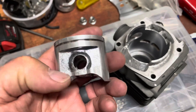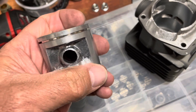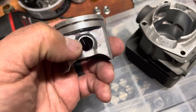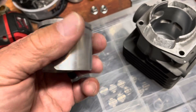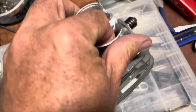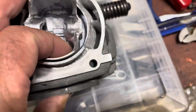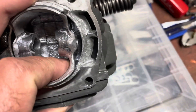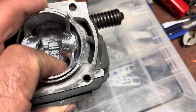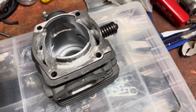We took material off and lightened the piston like I did on the last 2166 Jonsered build. I think I like that modification — when you put it in and it comes down to bottom dead center, it doesn't block off the transfer area, it gives more feeding area for the transfers. That one pulled strong and hard, so this one should as well.